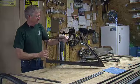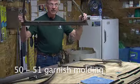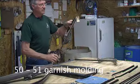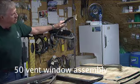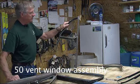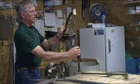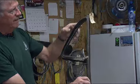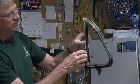In 1950 they changed it. The garnish molding is plain — no vent window — because the vent window has its own framework. If you notice how similar it is to the '49 framework, it's just that it is now attached to your vent window frame assembly. It's an assembly now, so it would go into the door. Your channel is here for your roll-up and down window, and everything else is basically self-contained. Here's your vertical seal for your vent window.